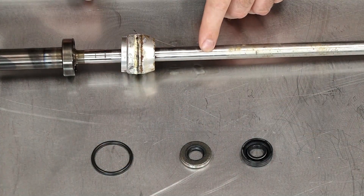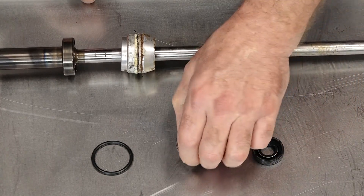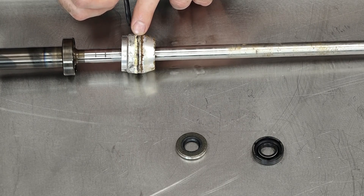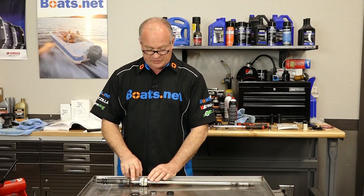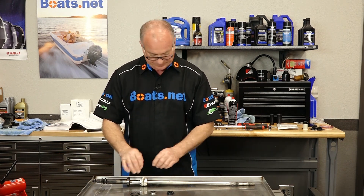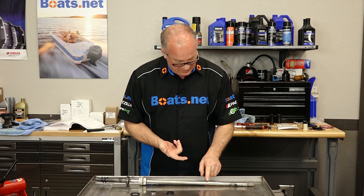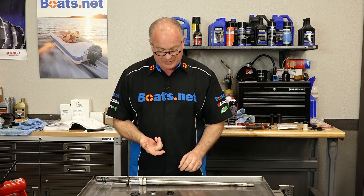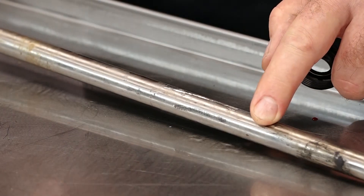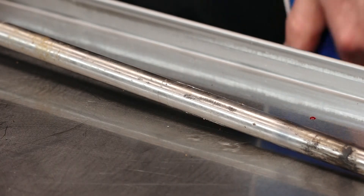Here's what we've got inside this little carrier housing: a neoprene seal up top, what they call a metal seal down below, and then an o-ring that has been encrusted on the outside. So we're gonna pull this off the shaft, remove that o-ring, then go in and pry out the seals and drive in the new ones. When I had the vice grips up top to knock this thing out, it actually scarred up the shaft itself. So when we go to put these seals back on, it's probably gonna cut into them. I need to grind this back, get off the sharp edges, and maybe use an emery cloth on it so we can reuse it.